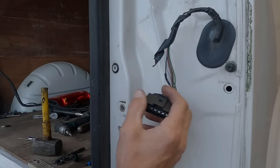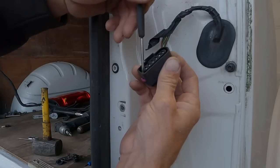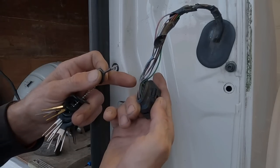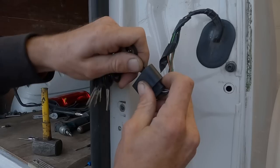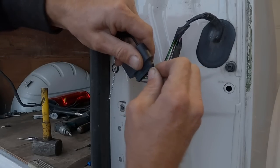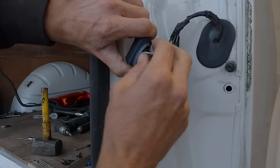Starting on the driver's side. Inside there's a little purple clip — we just shimmy that out. Then I've got these de-pinning tools. I don't know what side the pin is on but we're going to find out. I've got my de-pinning key in there, giving it a little tweak — try the other side. There's a pin either side, so let me put one in either side — the front and the back.